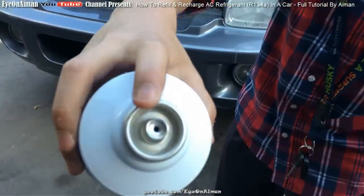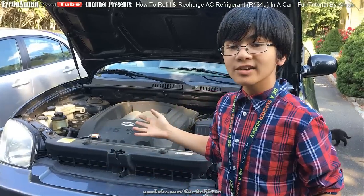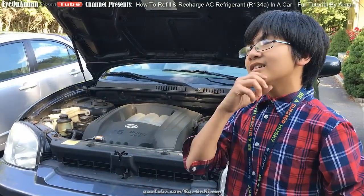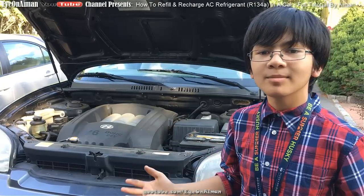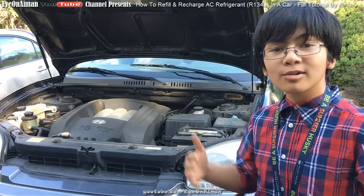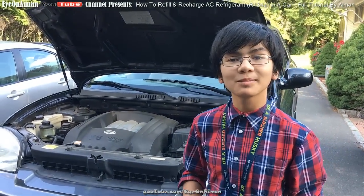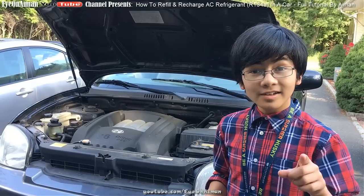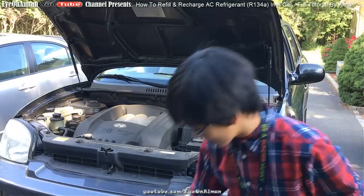Before I wrap up, here's the hole on the refrigerant can. Today we learned how to refill the refrigerant in a car. With that, we came away with a lot of knowledge — we figured out how to diagnose the problem, like the compressor clutch issue. We couldn't tell the problem was there before we filled the refrigerant, but once filled it had to work more, and that's likely why it showed the issue. It's good that we did this because you can see how we diagnose the problem and the success. Alright, I'm Ayman — thanks for watching. Please like, comment, subscribe, check out other videos on Ay and Ayman, and keep looking out for the next video on how to replace the compressor. Mechanic Ayman, out. Peace.